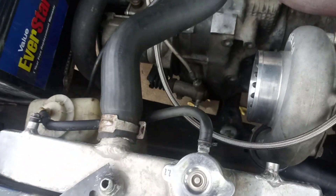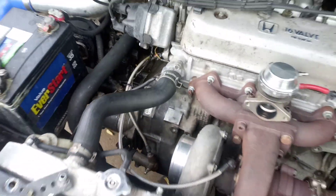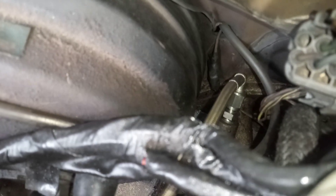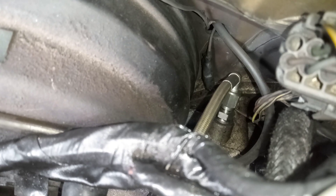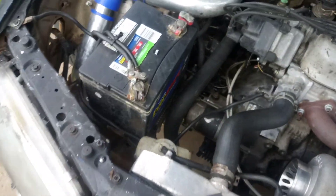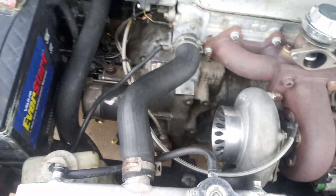I went with a hard line for my clutch because I got rid of the stock clutch line — it was causing too much trouble, kept losing pressure after so many runs. There's the hard line right there; I just tucked it along the firewall just like the old clutch line, ran the extra wire over into the corner straight into the chassis. Works just fine.